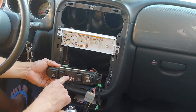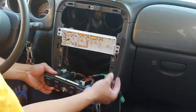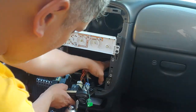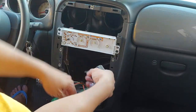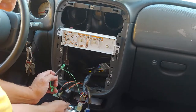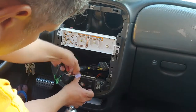I went ahead and drilled the hole, took the switch, pushed it through, then took the nut and tightened it up where it needed to be. I left my on and my off marked with a little sticker. One thing that's important — I have my battery on, so this is live. My antenna ground — make sure that the antenna wire doesn't touch your cigarette lighter. That's why I have it hiding back here, otherwise I'll blow my fuse. In the previous video I showed you how to do your harness — so there it is, all wired, nice and beautiful. Here's my wire for the e-brake going to one wire of my switch, and the second wire goes directly to ground. We're going to trick the stereo into thinking it has the e-brake on.